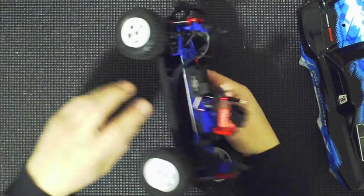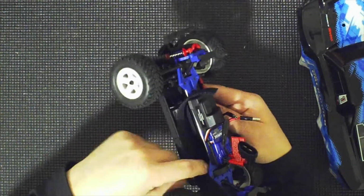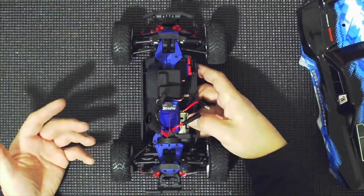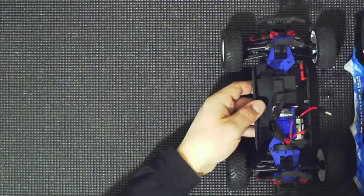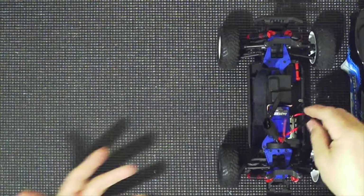So I'm thinking that's probably what was happening. If you fried the motor, it was probably because it was creating too much friction there at those points. So slowing the vehicle down, it's probably creating too much resistance for the motor. So let me grab mine, and then we'll try to test it just to make sure it's the same test and it's a valid test for this motor.